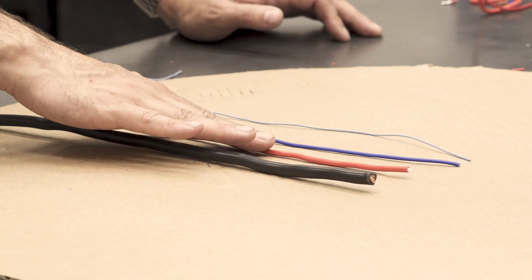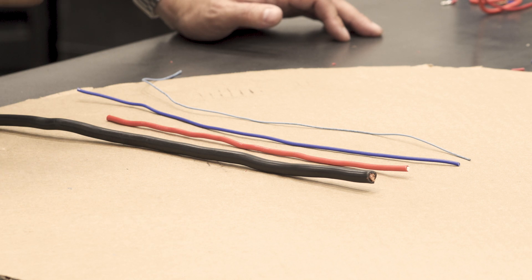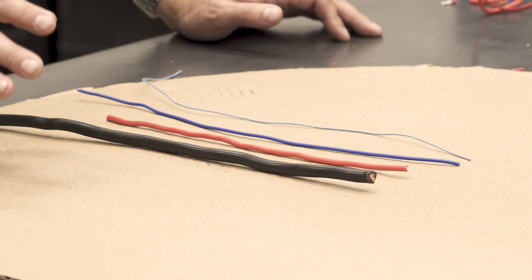When you get into something like a car stereo, that's closer to 10 or 15 amps, you're going to want to get into the 16 gauge or maybe even the 10 gauge wire to run that power. Because it's pulling more amperage through the wire, it needs to be thicker to handle that current draw. So this is a scenario that hopefully you will never encounter in your car.